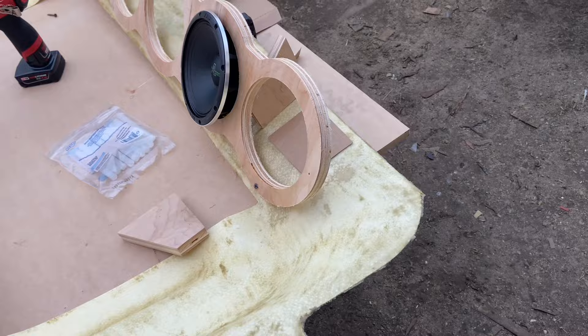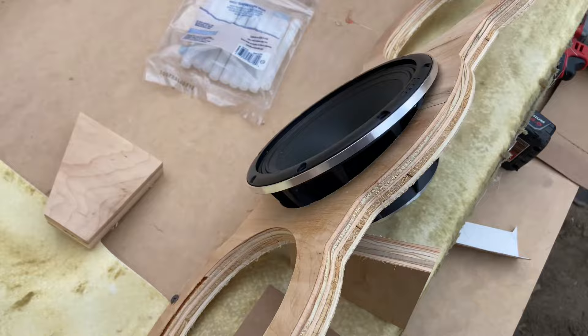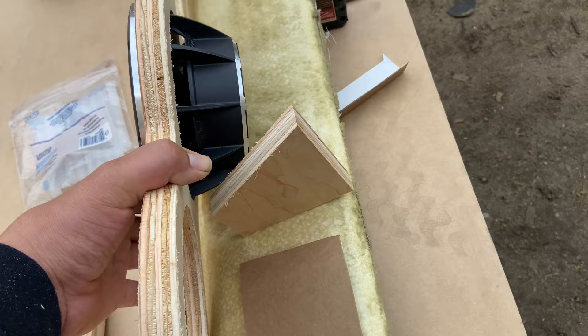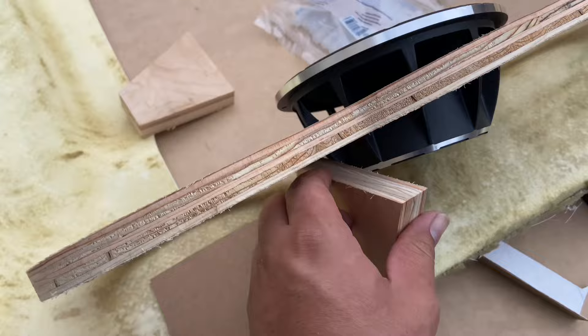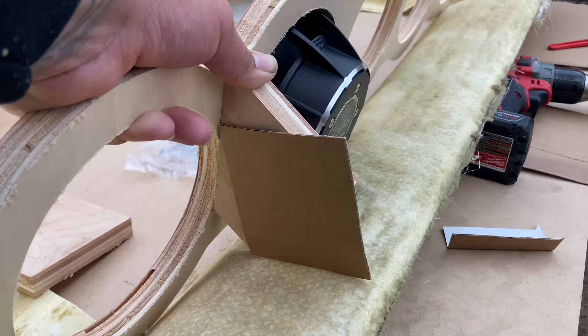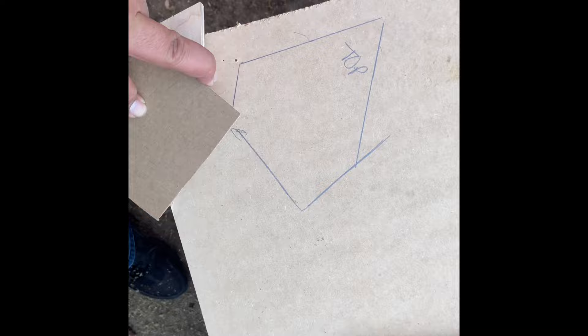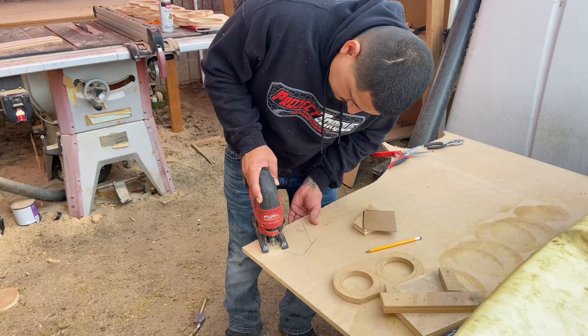Okay so here I mocked up my template. In order for my speakers to fit I'm going to want my template to be sitting pointing pretty much straight forward. I have a brace that I normally use for the universal roof panels, but obviously that's not going to work here because I would need it to be like this. So there it is - that is straight and the piece of cardboard is sitting pretty flat at the bottom. So all I did was trace this and I'm going to cut it right now and see if that lines up.